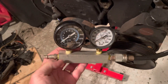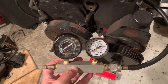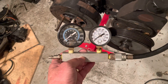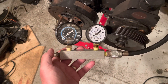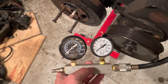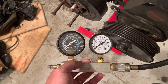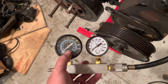The way a leak down test works — I built this homemade leak down tester myself. This is your incoming air pressure and this gauge is on the incoming side, and then somewhere in here is an orifice. The FAA sets the orifice size to 0.040 inches, so it's an orifice I've drilled to that size. The air pressure comes in here and you adjust your regulator on your air compressor to read 100 psi to make the math easier. If your pressure switch on your air compressor typically shuts off at 120 psi, it gives you a period of silence before it drops down to 100 and restarts the compressor. So you set the compressor regulator for 100 and it gives you 100 psi on this gauge.